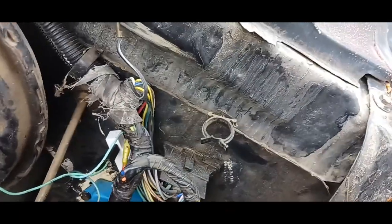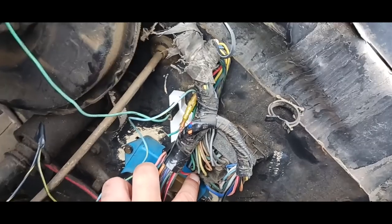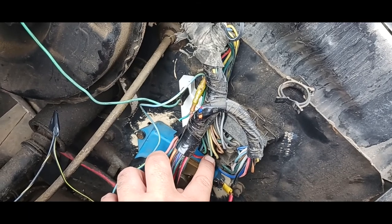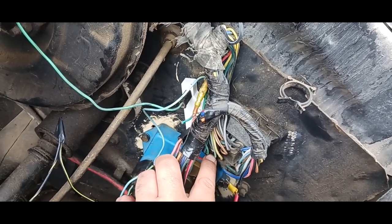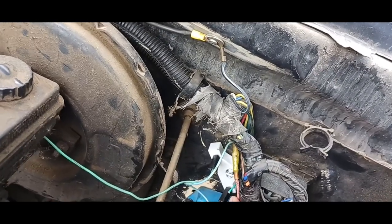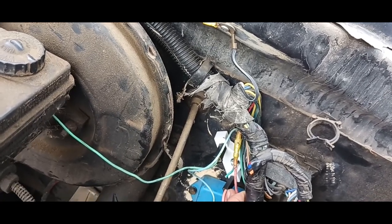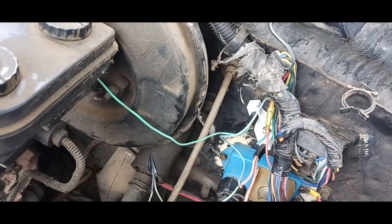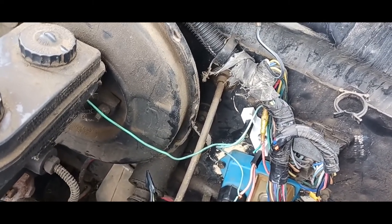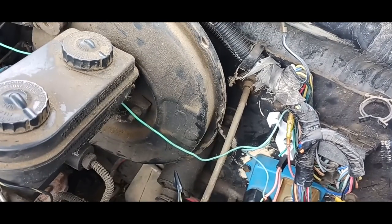I'll try to show you so you can take a picture. On your wiring harness it's the bottom row, second one in — there's a green one and then a red one. That red one I wired into the bottom side of the resistor, because I believe that is a steady-on in the run position to feed it power. The second I did that, it fired up.